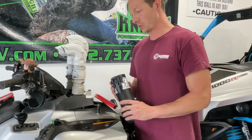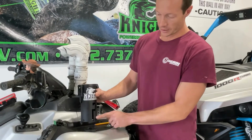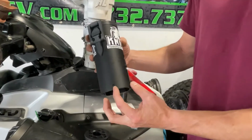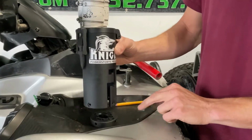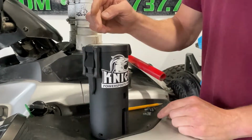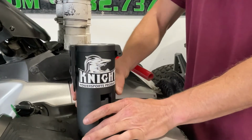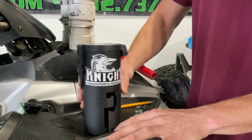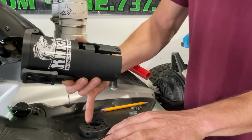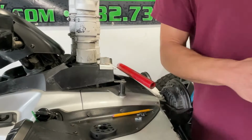So after you put this one screw in, before you drill the other two, if you want to just test again and see that it's going to line up exactly where you want it, you have the 4 screws that connect your cylinder to your mounting puck. So I put it down on here and I'm lining those up, and I can see that the position I have it in is not exactly where I want it. I want this to be rotated like this. So I know I need to move the hole that this screw is in to a different hole so that I can rotate the mounting puck to rotate this.